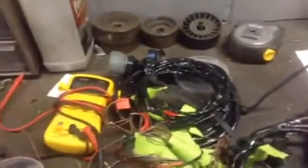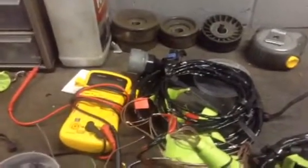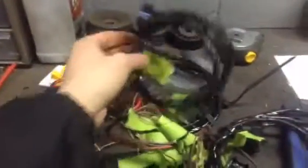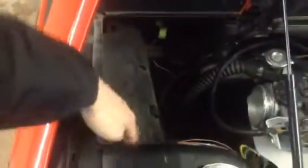So then all you have to do is redo that part of the harness. You don't have to rip apart the whole entire harness to get that one sensor. So I would highly suggest just doing one sensor at a time. So this is one wire length and everything's good. Another benefit of doing that is you can tuck everything away. I'm going to tuck all my wires right along here, all the way here, and all the way back.